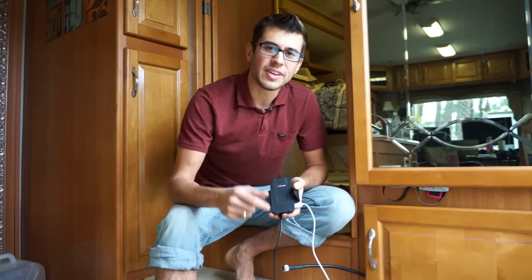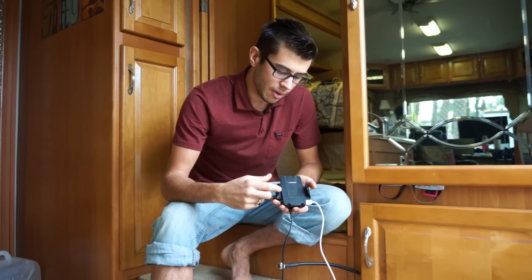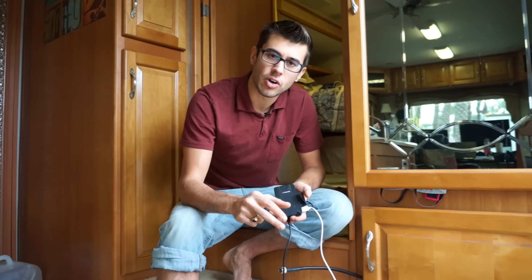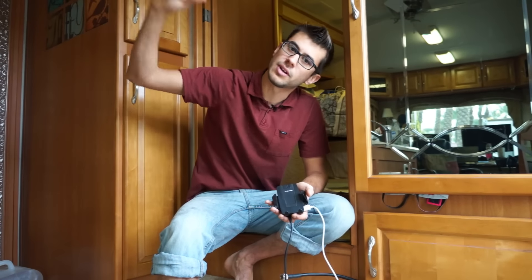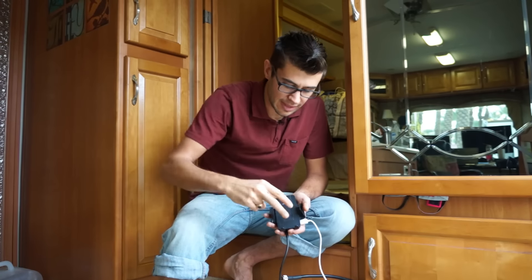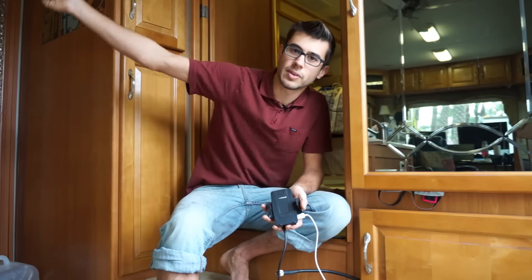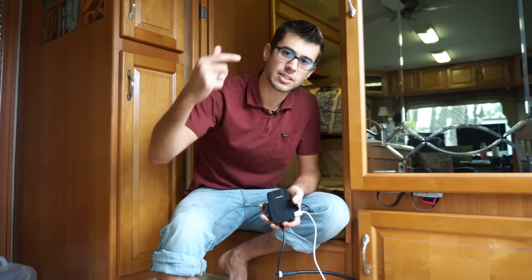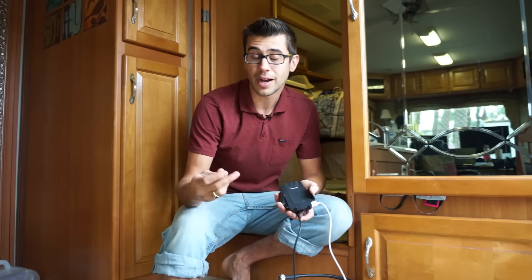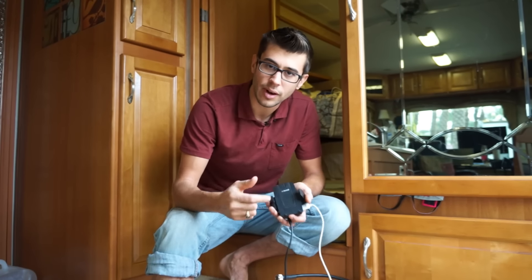Now we want to use this cradle booster in our RV, and here's where things get fun. The other more expensive, powerful cell boosters on the market utilize a secondary internal antenna inside the RV. You put an outside antenna on your RV and an internal antenna, and you rebroadcast the amplified signal inside with another antenna — just like this does, except this only broadcasts it right here. So there's no way it can interfere with the outside antenna. With an internal antenna, you have to worry about creating a loop or interference between the two antennas, which means you have to position them properly, and you could actually degrade your cell quality. I've messed with that on a larger industrial scale and it can be a real pain. So I chose to use this so I don't have to worry about that.